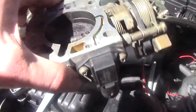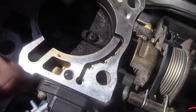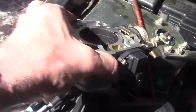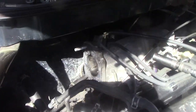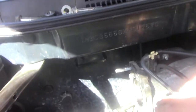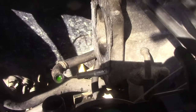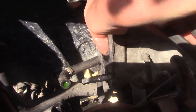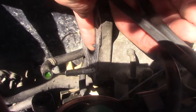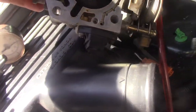right position. So I started looking at the map sensor, and that's where it's located, and the channel that follows it down where it gets its signal from the intake. So the more I looked, I discovered there's no gasket on here, and I'll make sure this shows up. Not only was it a silicone gasket, but right there where the reference port for the map sensor is, that gasket has pretty much completely clogged that passage to the map sensor. So that's no wonder it wasn't responding.